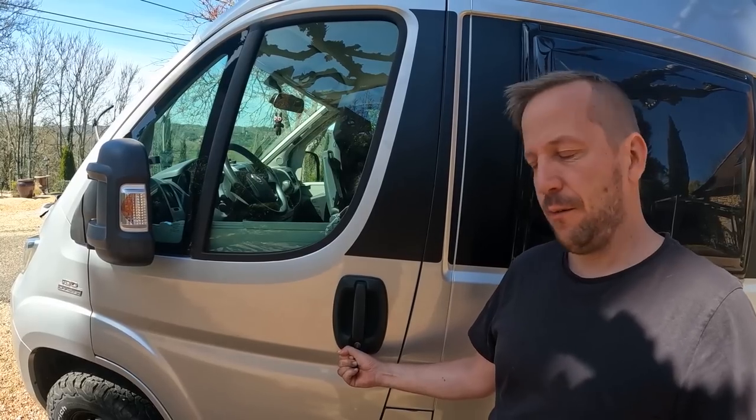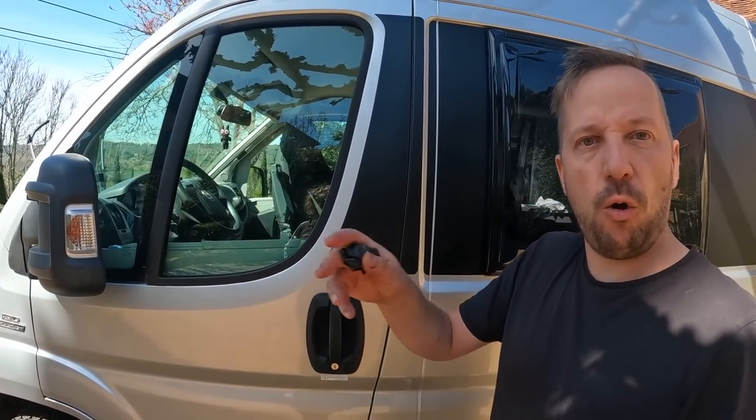You can open a Fiat Ducato's door with a screwdriver. Just point the screwdriver here a little bit upwards and do this. It opens the whole lock mechanism in the van. There is a plate sold which actually fixes that problem.